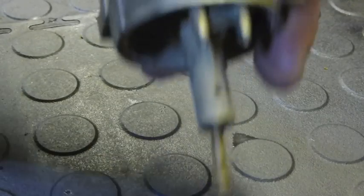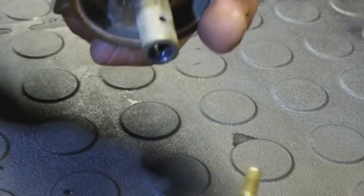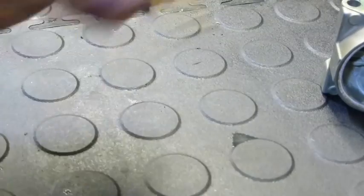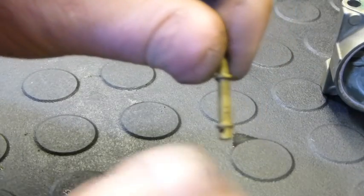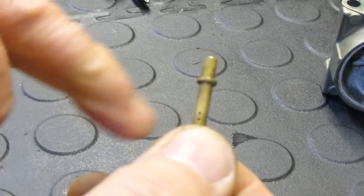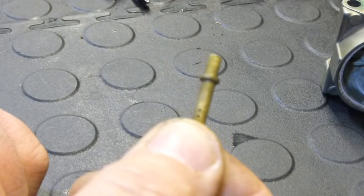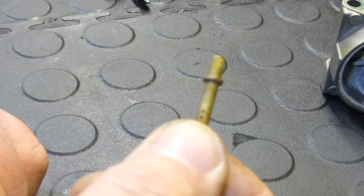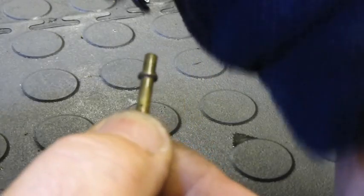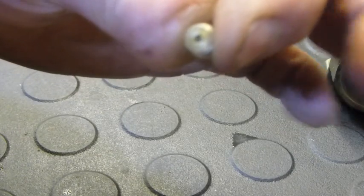Now the nozzle rather just drops out the bottom as well. There's the nozzle. What gets blocked and makes these things run rough is these tiny little holes up here get blocked. They'll cause it to hunt and surge and do all sorts of things, as well as the hole in the nozzle itself — a little hole up through the middle.